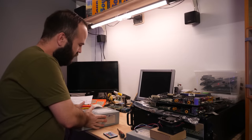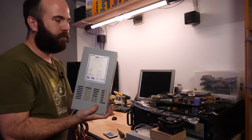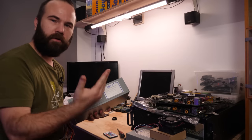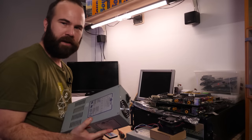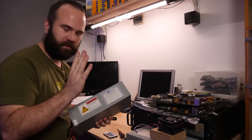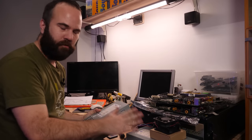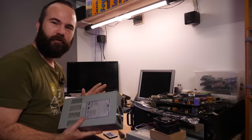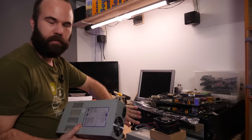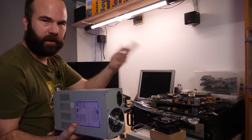So what got in is two extra Quantum3D power supplies, but these are not mine, but they will be recapped and repaired and checked by Dave. One of them I already opened, and the caps seemed all right on those units, only there's a spool loose on the PCB, so it needs to be checked. I also got some spare fans to install in them, so Dave will get four more power supplies, because my first power supply is already up and running with new capacitors. I still need to get it back, and then it will go in this chassis, and I will build it up, and then the four other power supplies go in for repair.